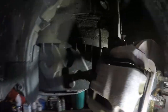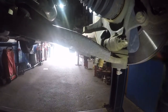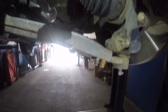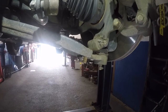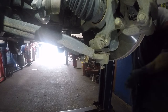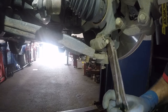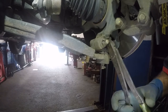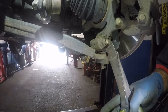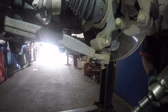All right, that's my apologies — let's go on this side. So there we have it. I thought it was going to be easy but no — you've got a cotter pin over here which doesn't look so bad. There goes the old tie rod. This cotter pin should be easy to take out — very easy. Now what I can do is put a 17mm here and a wrench on the opposite side. That should just bang it right out. Very easy. You might have to put a wrench on the other side so it just doesn't spin.